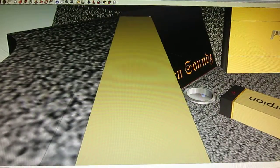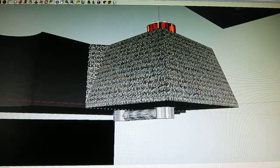You would have to brace it here and brace it here with some exhaust hangers, and they would have to have grommets on them so it didn't pick up any floor or road noise. And all of it, except of course the inside, would have to be sprayed with a spray liner, so it would cut down on any vibration as well as those hangers, and it wouldn't pick up any road noise, which you definitely don't want. Once you do those 2 things, it shouldn't be a problem at all. Also, you have to have grommets anytime you go in and out of firewalls or any sheet metal of the car, because it's impossible to isolate all vibration. Grommet here should be totally fine.